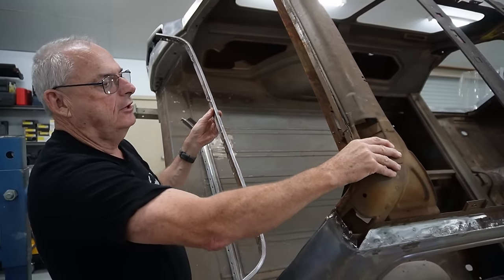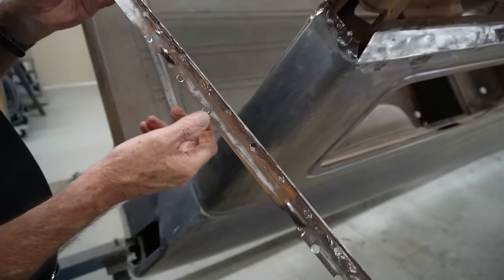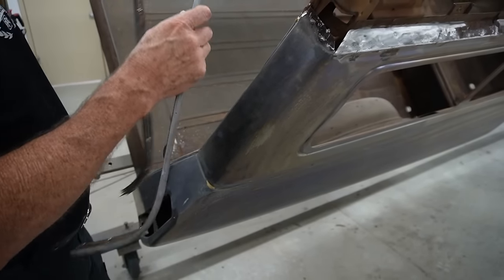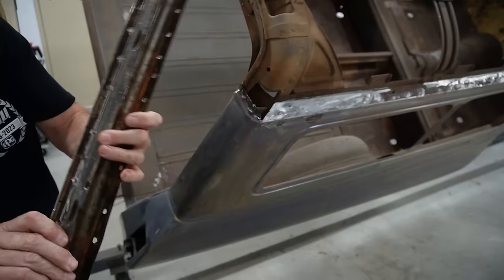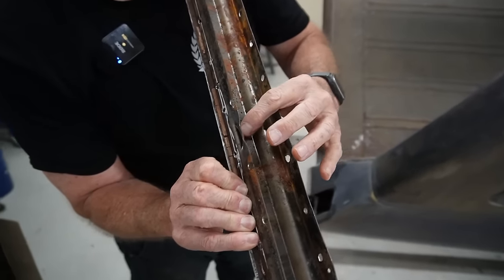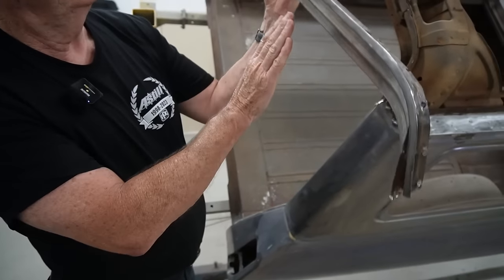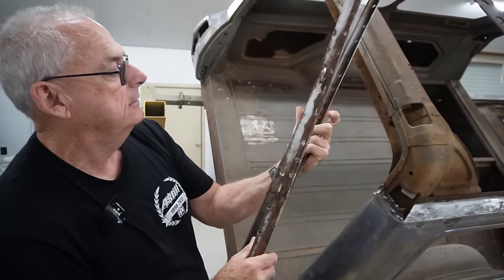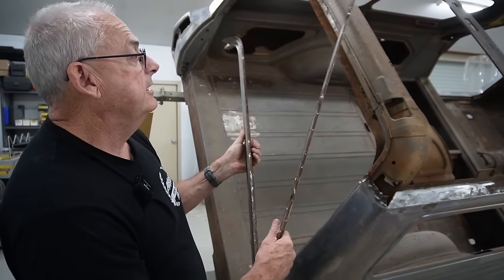So we've still got the structure, now we've got the drip gutter, and it's interesting, it's got these little bumps in it. So we're going to need to put those back in, because what we've worked out with that is when this panel goes on the underside of that, if I can get that in position, the factory's put that in there so that, oh, look at that sharp one. So they've put that in there so that this panel will sit on there so that it makes it the right depth on this side, because that becomes the shape of the car. So sometimes you look at things and go, wonder why they did that. So when we make that gutter, we're going to need to put something like that back in there to make sure it goes in properly. So that's all come off really good.